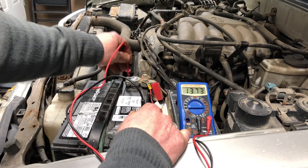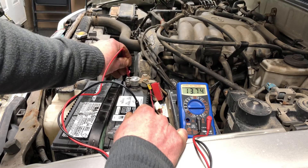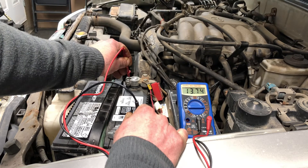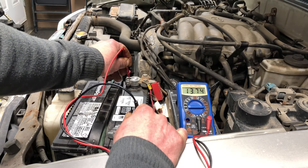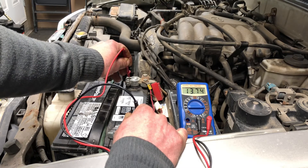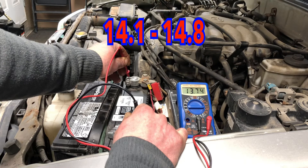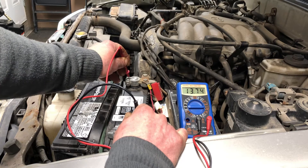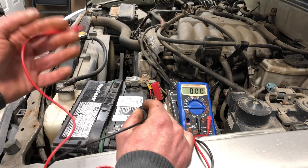It's a lot more than what it was, but it's still not optimal. But I've never had really any problems with this. Until my battery starts going dead, I'll just keep driving it, or until the alternator totally gives out. But it's low. This car has 400,000 kilometers on it and it's still the original alternator, so it's gonna go down a bit. 13.7 even still keeps it up, but optimal is, like I said, 14.1 — which is 0.4 points away from what it's charging right now. So that's not bad. If it had only said 12 volts or 12.6 when I started it, we'd know it's not charging.